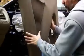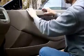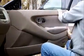Put your panel on. Hold it here, plug it in — that makes it easier — and then you just roll it around there and pull that through. The difficulty really is lining that up. If you have the window all the way up, it can put pressure on there, so having the window down makes it easier. Once you've got it on there, just kind of wiggle it back and forth and make sure that hole is lined up.